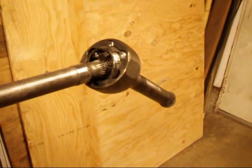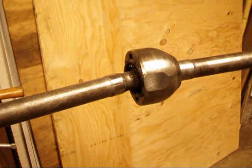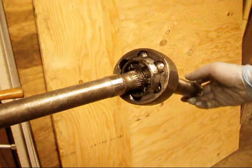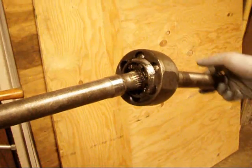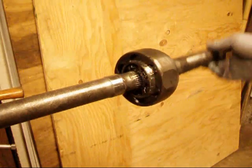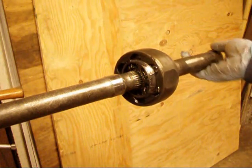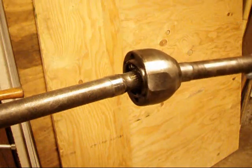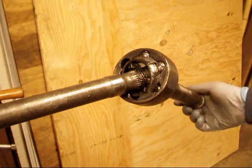After a couple of years, Bobby Long of Super Axles started making completely new aftermarket Birfields that they call Long Fields, made out of much better material. It's hardened to the right hardness so it's still got a little bit of give in it. They started making thicker outer cages and better materials all the way around, and those joints will survive some enormous tires. I've got a buddy running 39.5 Iroks with an extremely heavy foot and a really strong engine, and he hasn't been able to break these things. They also make aftermarket inner shafts now that are way stronger.